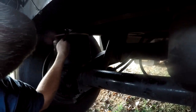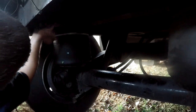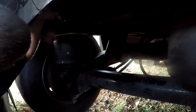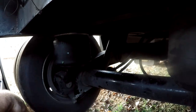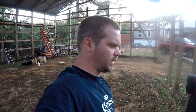And the plug that I need is just a quarter inch NPT plug. I don't know if I have one of those, but if not, I can run to Lowe's or somewhere and pick one up and screw that in there real quick and be ready to go. But that's about all it is, putting it on there. Like I say, usually you got to jack it up or some kind of way to get this axle to drop down like that. But lucky enough to have this ditch here today, I backed in. But I'm gonna go get a half inch 13 thread nut and put on the bottom, and I'll go get a plug and put in there, and this job will be complete.